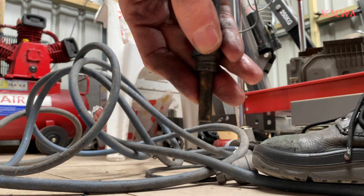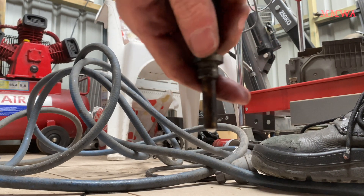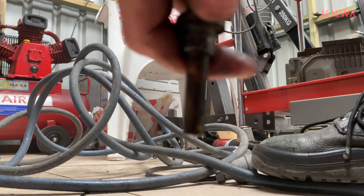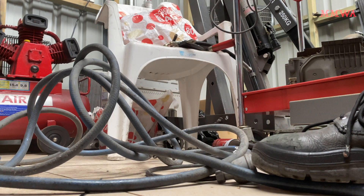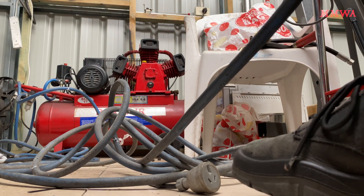So I only put a small amount in there. We can already see the spray pattern that this thing has. Those dribbling bits are just residual pressure in the hose — when it's actually got the full pressure applied, this injector does have a pretty decent spray pattern. This is just a junk injector I had lying around from Red's original setup. I have no intention of ever using it again.